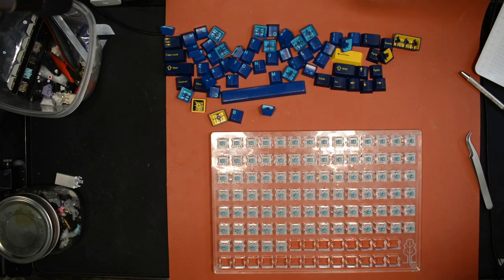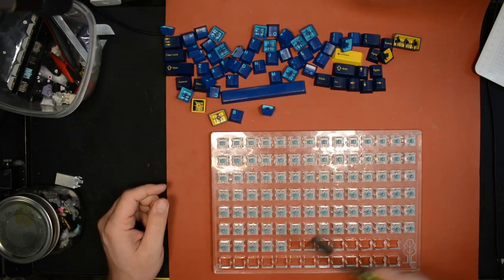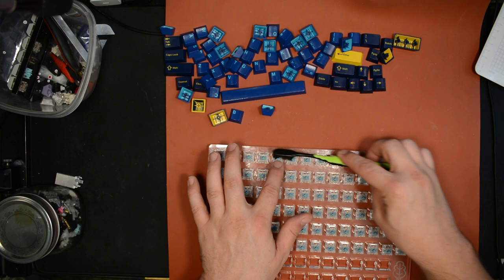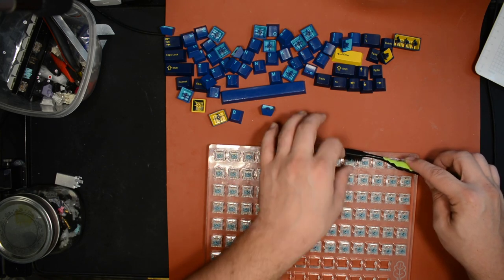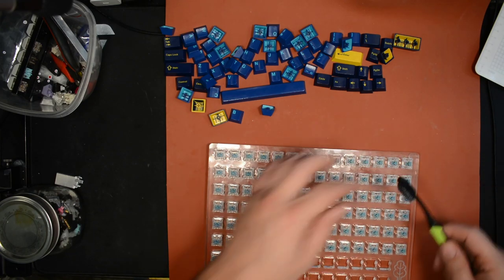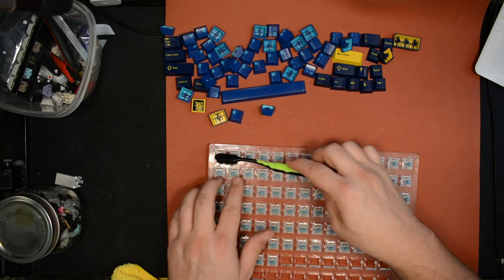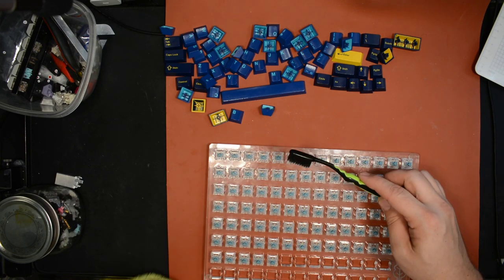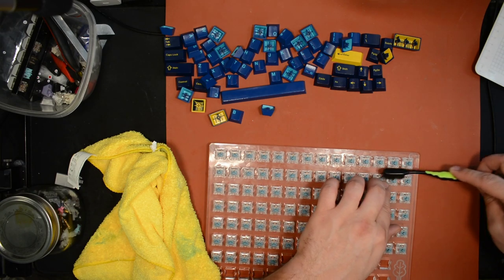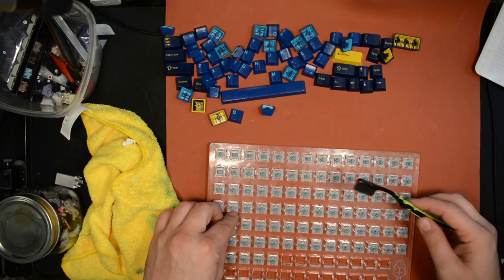Now I mentioned that if you tub lube, you get some grease on the cross. So one way you can minimize this is you can remove some of it with a toothbrush after you're done modding the switches and lubing them. So this is a Colgate toothbrush with fine charcoal bristles. So it'll pick up some of that lube. Then I wipe it on a microfiber rag. So you usually do one row of switches, then I'll wipe, then I'll do another row of switches.